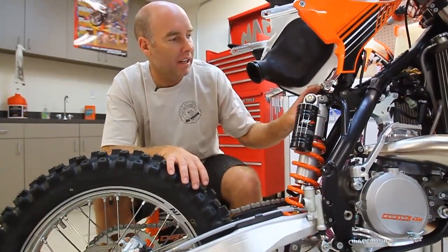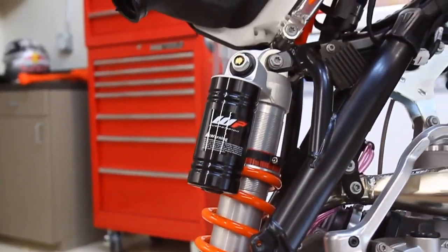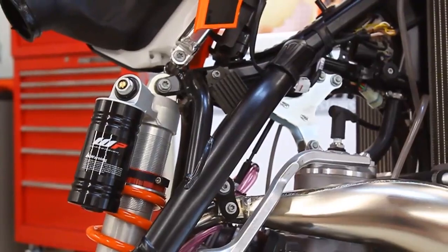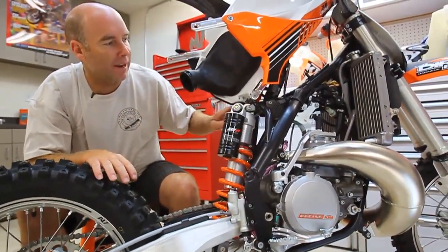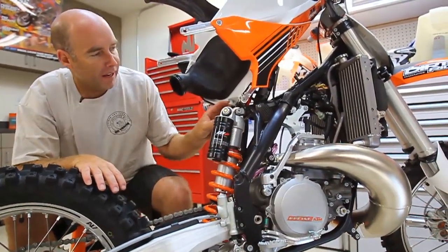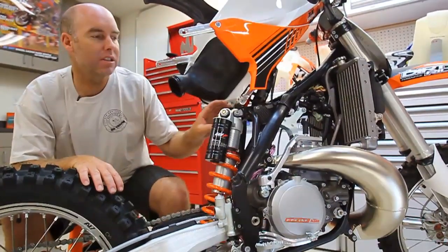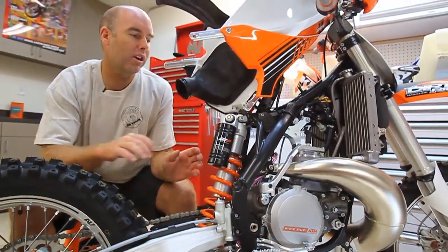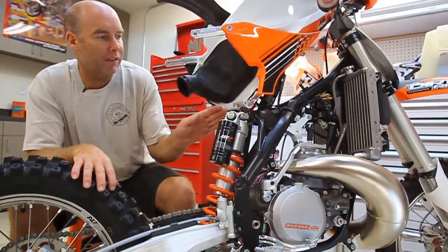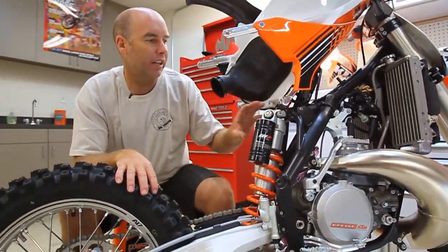This is the XC. It has the link, but it's also unique in the way it's mounted to the back of the frame. What KTM has done is instead of mounting it directly into the back of the frame, they've built this tower and extended the frame backbone, swung it up a little bit, and mounted the shock out here to try to isolate some of the forces. When your rear wheel hits a bump, it sends all that force up into the shock, and instead of transferring it straight up into the frame, it's isolated back out here — and there's a lot of flex character that controls what you feel through the handlebars and the foot pegs.